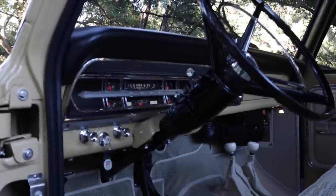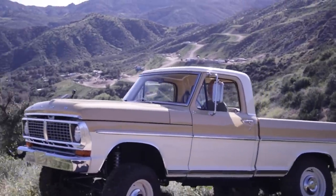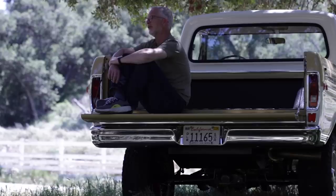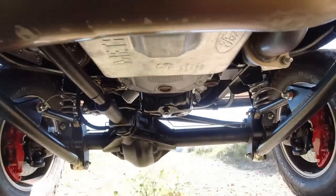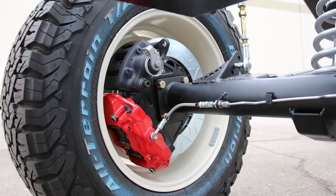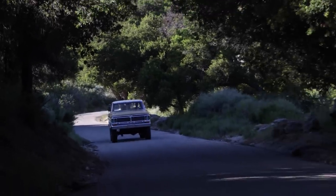For the transmission, we're running the Ford AOD automatic with overdrive, and then we're running all that power through the Atlas twin-stick shift-on-the-fly part-time four-wheel-drive transfer case — the Highlander case, which is a 3.5 ratio in low range and one-to-one in high range. We didn't do lockers on this one because it's not really going to be a trail-duty truck. We did do the Dynatrac axles — the rear being a Dana 60, the front being a Dana 44-based unit with Superior fine-spline axles and all other possible internal upgrades. The housings are new all the way down to the castings. The brakes are the Icon Brembo sport brakes, hydro-boost assisted, featuring six-piston front calipers, four-piston rear, plus a dedicated parking brake in the rear.